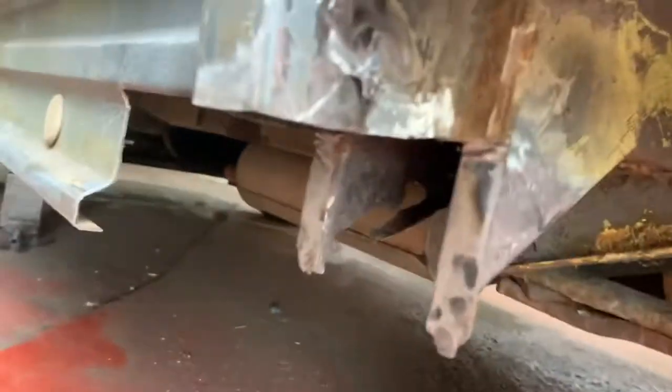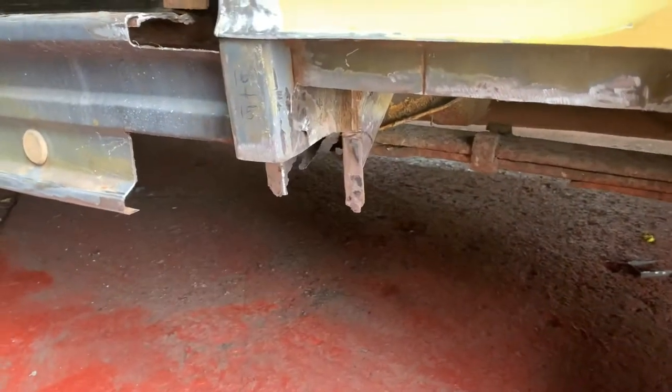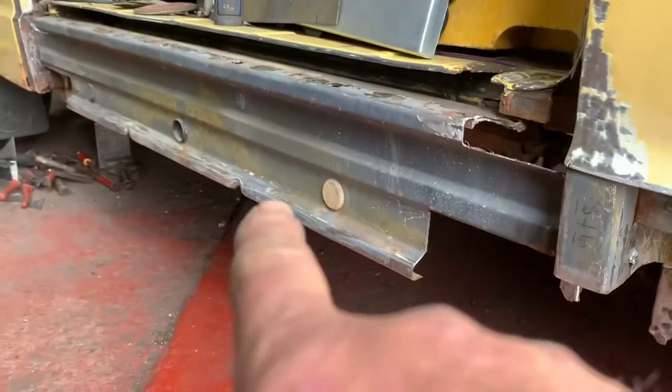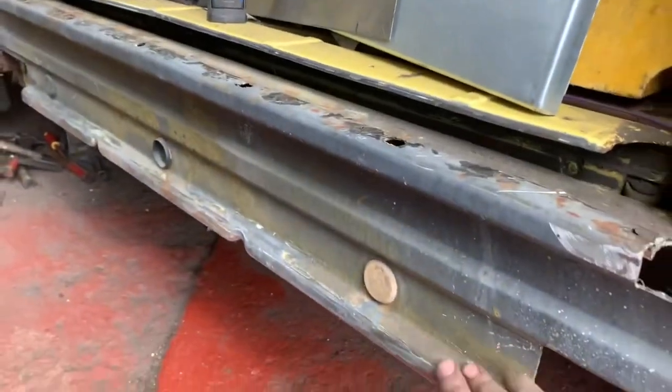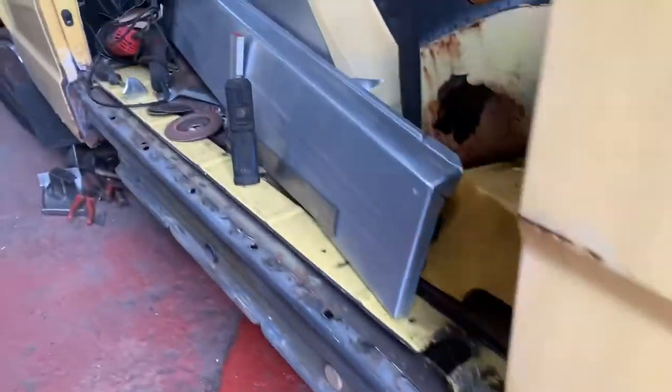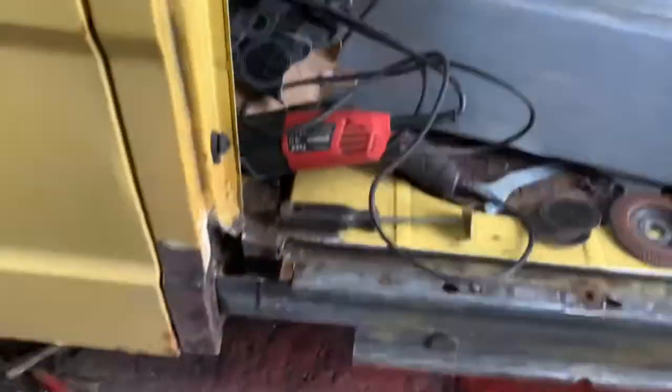And then, let me creep down here. As you can see, the rear inner sill, well, that had gone, and the jack points have really quite suffered. So I fabricated and bent up a new jack point, she sat over there. So that'll be tomorrow's tack in. So we get the jack point in, get the sill repaired and rebuilt along the bottom here. There's no point changing this whole panel. To be honest, it's pretty good. And we've got a press brake, so we can fold these bits up. And then I'm going to do a bit of love there in the corner. And then we're ready for the new outer sill panel. Anyway.